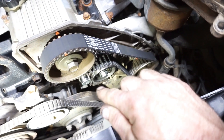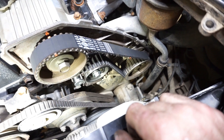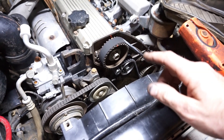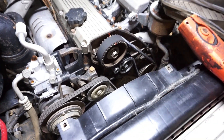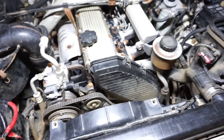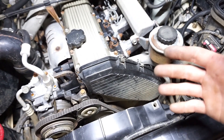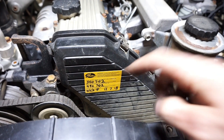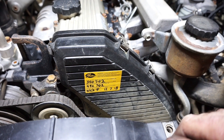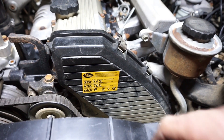Then we can tighten this bolt and this little hex head bolt there, and we should be right to put the timing cover back on. I've tightened both bolts now and spun it around twice, checking that both timing marks are still aligned — so I'm all good to put the timing cover back on. I've just finished putting the power steering reservoir back on and the timing cover, so that's all done. The final piece of the puzzle is the sticker so we know when to change it next. I'm at 390,000 Ks now, so when it gets to 490,000 we'll look at replacing that timing belt again. For now, we're all good.